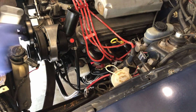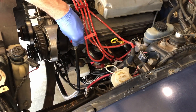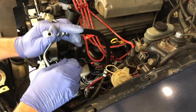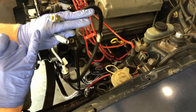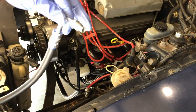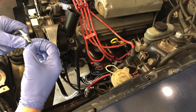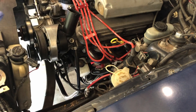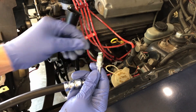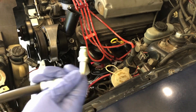Alright, let's go and do the next hose. With your hose should come two O-rings — you'll see two different sizes. Use the larger of the two because we're putting this end on the power steering pump. Lubricate the O-ring and slip it over the end of the hose. I'm going to put some power steering fluid on the O-ring and slip it over. This is what allows this end to spin and move freely when it's in the pump — it maintains that swivel action.